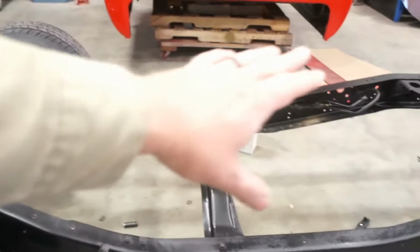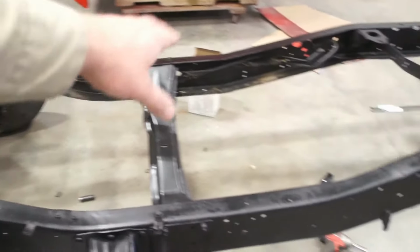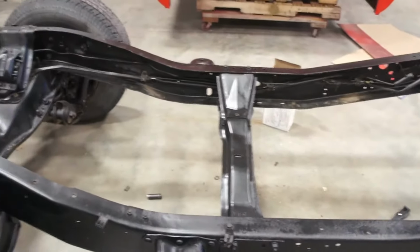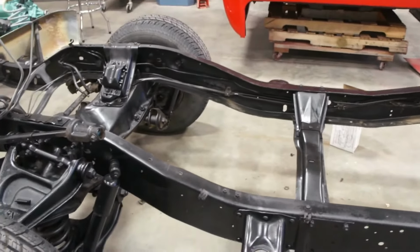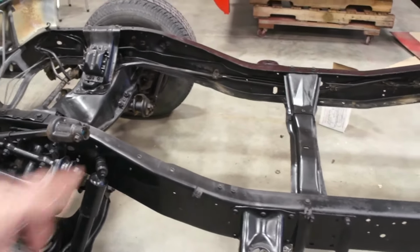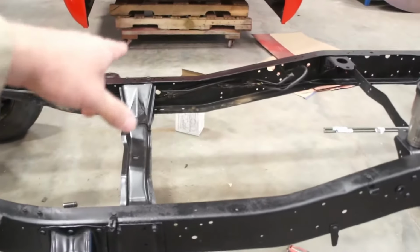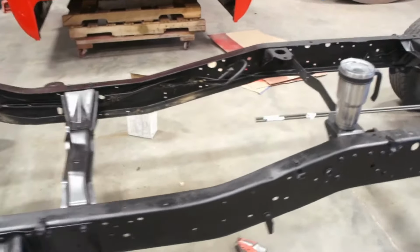Now, because I took the vent line out going to the charcoal canister, I had more room in my clamps on the frame. So I snipped about an inch of half-inch EPDM rubber hose, snuck that in the factory clamps, bolted them back down so they don't rattle and squeak. That'll be good to go.